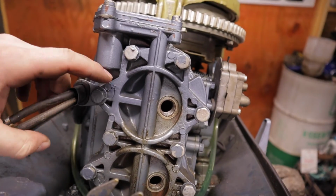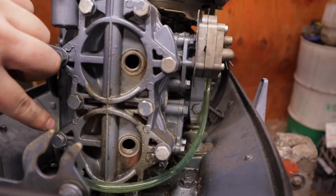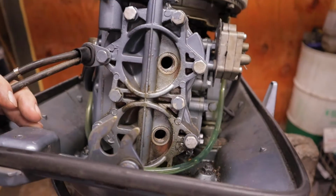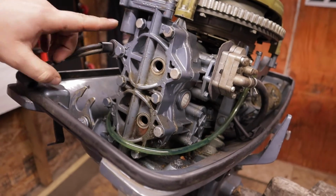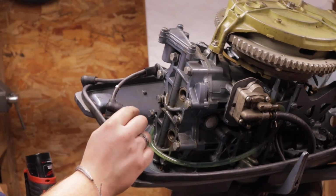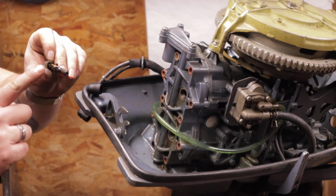These are so easy to pop off, little 2-stroke heads. We're gonna take off these 1, 2, 3, 4, 5, 6, 7, 8, 9, 10 bolts. Pop the head off. I have one sitting over there for it, and a head gasket. Could be head gasket, could be rings, but he said look into it, so we're gonna look into it. So let's pop these bolts off and get this head off. Most of these were loose, a couple of them were extremely tight. Wasn't torqued in sequence.